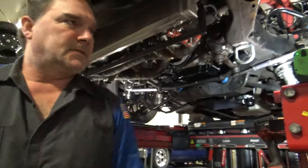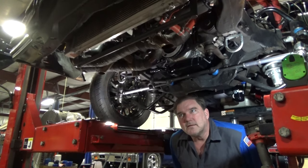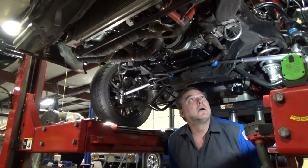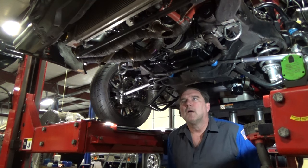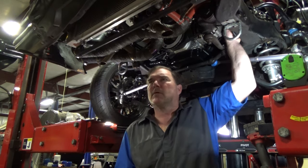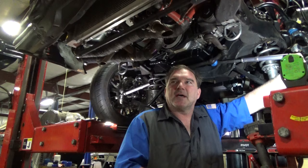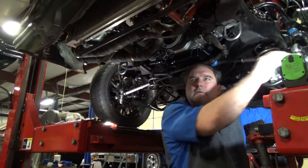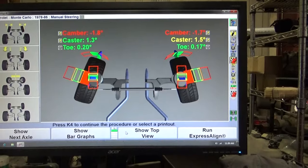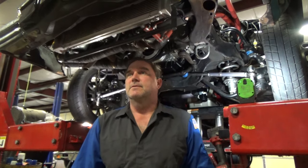That's our baseline static. We went just a little bit to the right but my total toe-in is negligible. You would have had to steer to the left just a hair — part of that might be the super tight ball joints in this thing. So that's on lift — I'll take it. That's about as good as I can make a bump steer kit right there, so I'm going to lock the bump steer kit down. That's awesome.